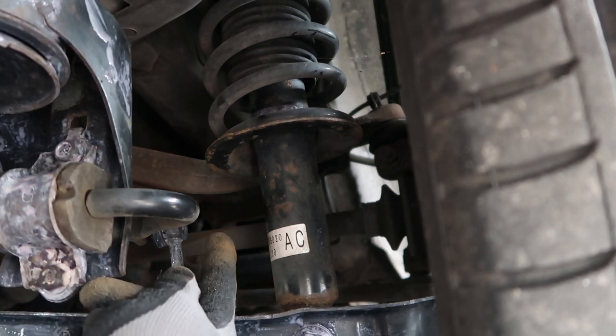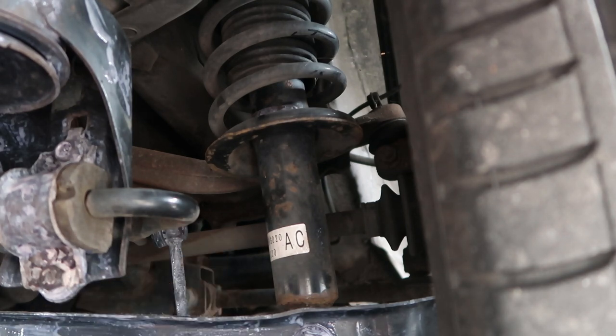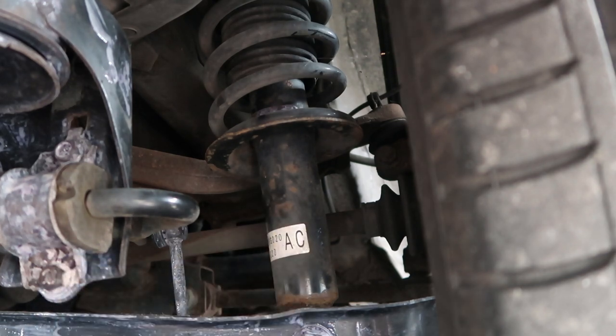This is the only bit I can show you like this, but you can see an arm up there. These kind of bits I'm probably going to get powder coated. In the joints where it joins to other things there's rubber boots and stuff, so it shouldn't start spreading. With regards to the powder coating process, you can get it shot blasted, but it can leave a potentially pitted finish. But it's probably cast iron and stuff, so it doesn't have the smoothest finish anyway — and maybe the powder coat will give it a smooth finish.